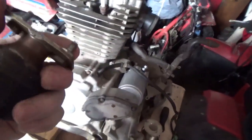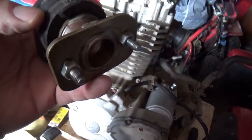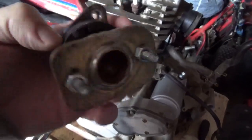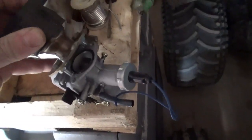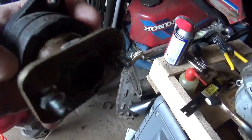To put one of these carburetors on, you need an adapter. Here's what the adapter looks like — I actually have it plugged right into an intake manifold. It's just an inch-and-a-quarter down to three-quarter fitting, and I take a brass plate, drill holes in it, and there we are. It could bolt on, or I could just slip the fitting in and bolt the carb right up to it.